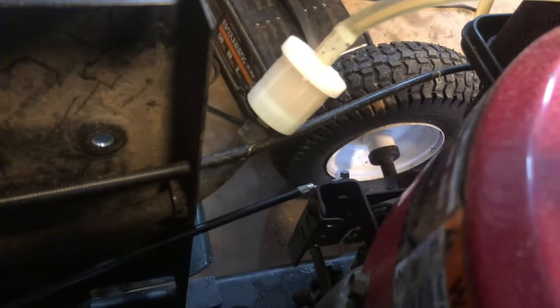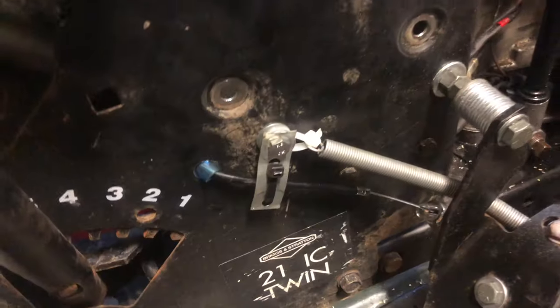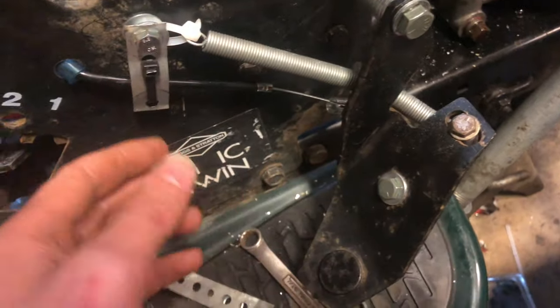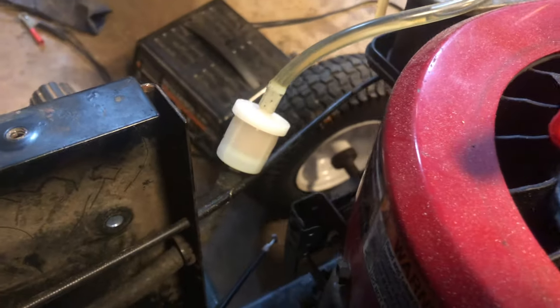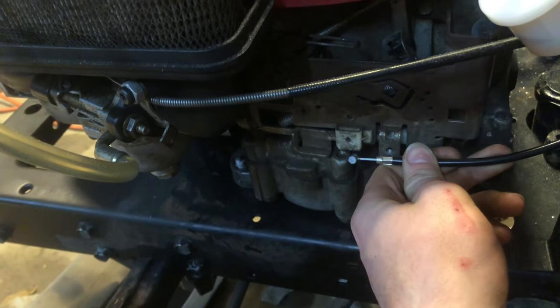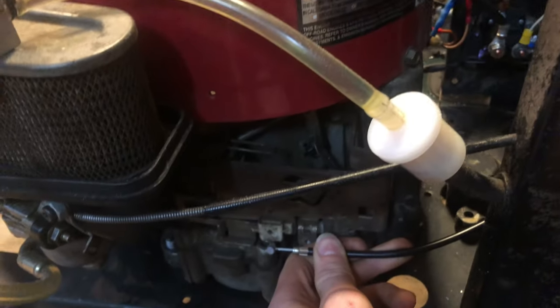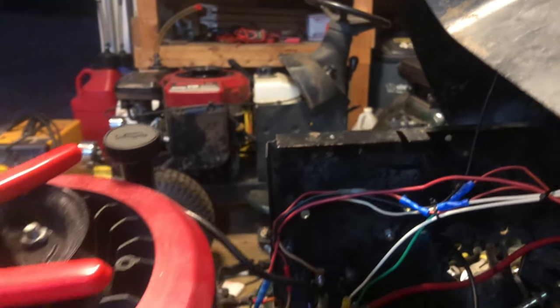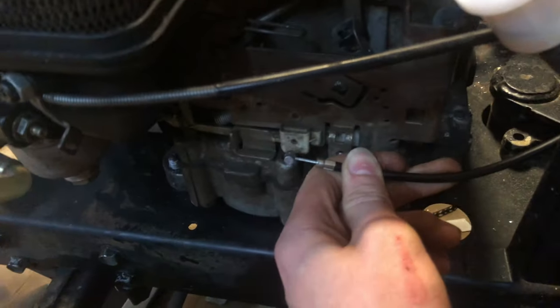Throttle cable came. That's going to go in there kind of around that steering shaft to right there. I got some other linkage components - I'll put that there, put this through it, and hook it all up and hopefully it should work. Got this cable hooked up - this took a little while to configure but it kind of works. It is not currently attached over there. Since this is the off-road lawnmower and I'm going to be going over a lot of bumps, I'm kind of wanting to hook the governor back up but set it to a higher RPM, because when you're going over bumps you can mash the throttle wide open and it could go extremely high. Also if you're pulling stuff or going up hills, the governor works better for that. For the meantime I'm going to keep the governor bypassed since I already got my throttle set up to bypass it.